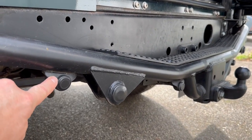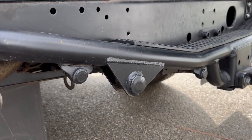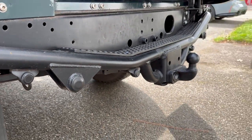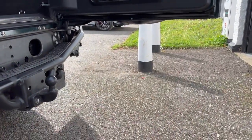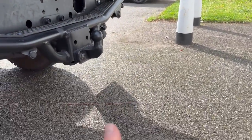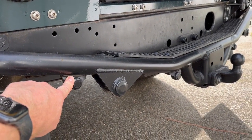These sensors are polarized, so they've got to go in the right way up. That's what I'm trying to say. And there's a little indicator on the back to tell you which is top and bottom. So the two end ones were in sideways. So if you imagine your sensitivity pattern being like an ice cream cone, but elongated like this, it detects quite well from left to right, but you don't want to see the ground. If you put one in at 90 degrees off the axis it's supposed to be installed on, it then sees up and down rather than left to right. So guess what? It picks up the pavement.